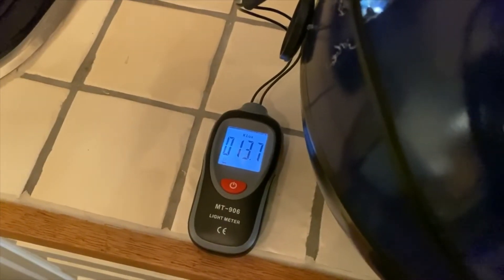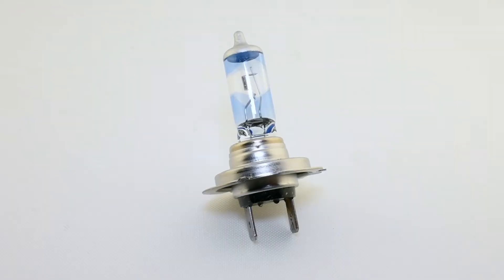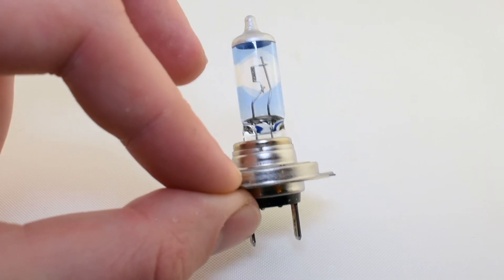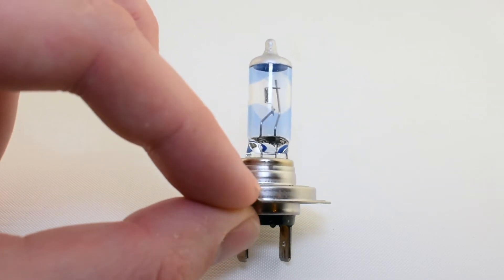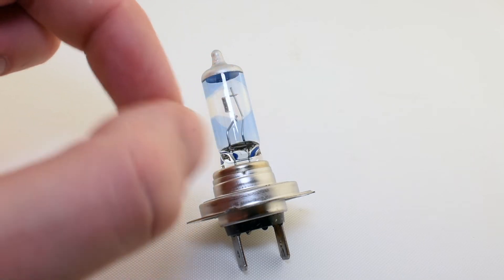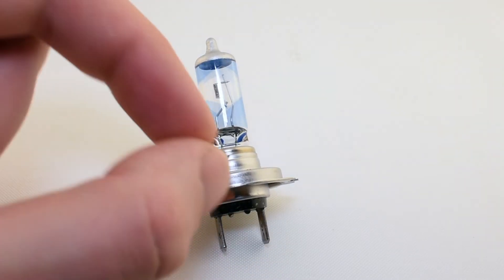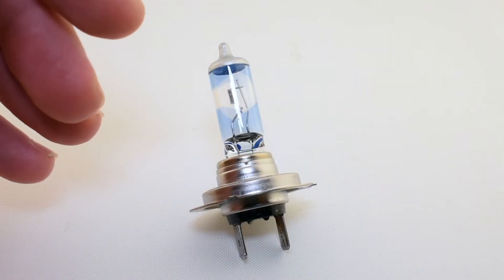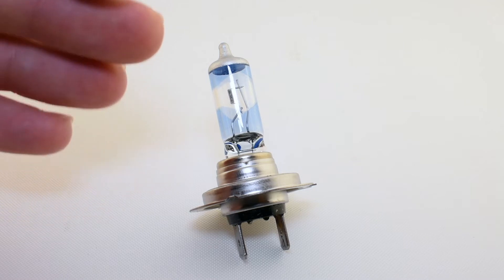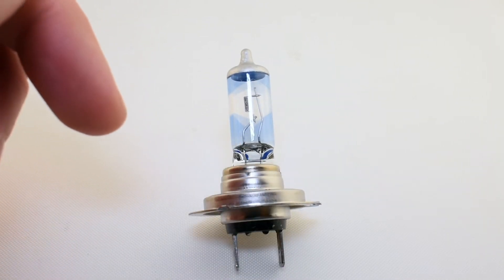Of course 70 hours is not much compared to a xenon bulb, but the degradation was less than I would have thought. Looking at the 72-hour bulb, we can see the tungsten coil has a little degradation — some uneven bumps in the coil. After 72 hours we saw a loss of 2.85%. These kinds of bulbs are rated at around 300 hours lifetime, so it's not really that long. Halogen bulbs are supposed to keep 95% of their brightness until they die — I don't fully believe that, but in this experiment the degradation wasn't too big.